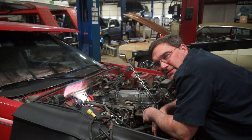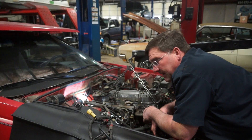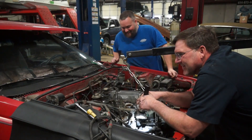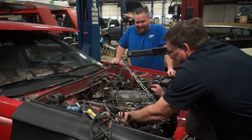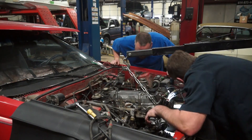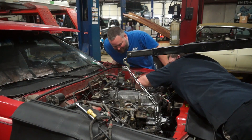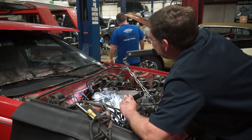This is why with stick shifts it's often easier to pull the transmission out of the bottom of the car, put the engine into the car, and then put the transmission back in. I need to get the shaft in another inch — let's give her a little push. I'm not on the splines yet, so I'm not in deep enough. Give her a push, wiggle it, put it in and wiggle it, jiggle it, get that depth. I think your sense of measurement is a little off there — it's more like two inches. Everything's bigger than you think it is.